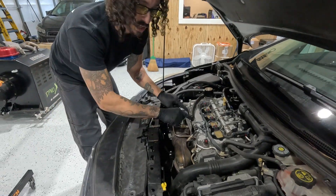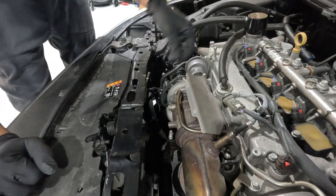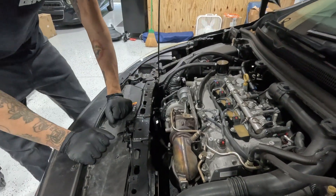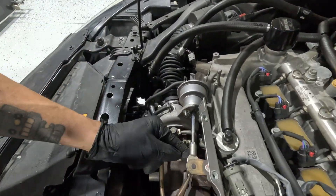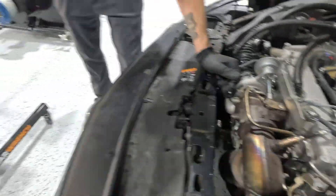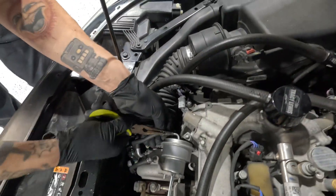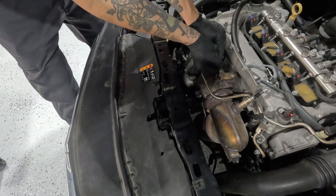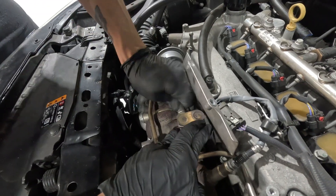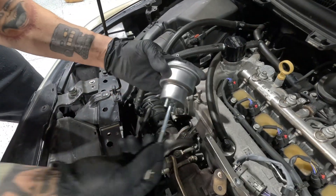Usually what I do — it's also connected to here, this is part of the heat shield — you're going to want to just go ahead and bend that up out of the way if you don't really care too much about that. Now we're going to take our pliers and go ahead and pull the pin. Then take our pliers again and remove the clamp off of the hose to the wastegate. From there you should be able to pull and drop it off, and then go ahead and pull this out.